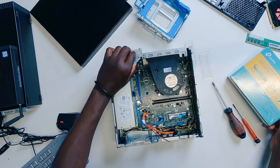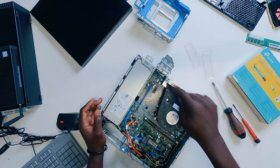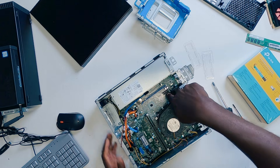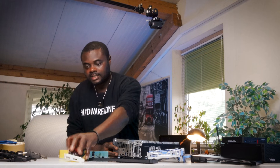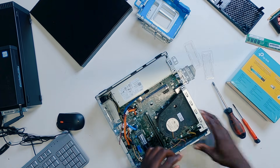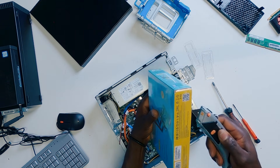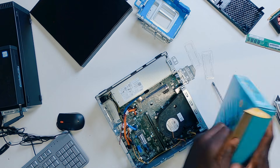So I'm going to go ahead now and open this up right here because my wireless LAN card is going to go onto the PCI slot right there — the black one — because there are two. If you have a graphics card, then that's going to go onto this PCI slot right here. But because I have this small one, this is exactly how it looks. So let's take that out.